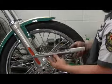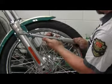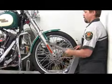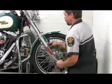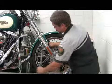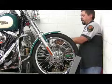This is a micrometer style torque wrench. You simply turn the bottom until you reach your desired torque setting, which in this case is 21 foot pounds. Then we're going to torque our fender nut. This is a clicker style torque wrench, so it'll click when you reach your desired torque. Torque the other side.